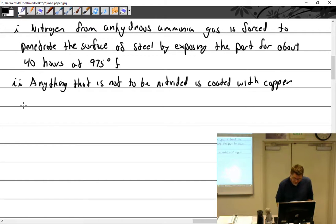The copper coating is significant — what in your pile of parts is copper-coated? The camshaft. The lobes and the bearing surfaces are nitrided, but everything in the middle is not, because it doesn't all need to be hardened. They coat the middle sections because nitriding causes the part to become very, very hard — and if something is too hard, it's prone to cracking and becomes brittle.